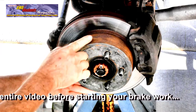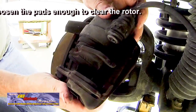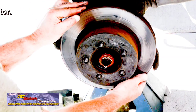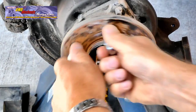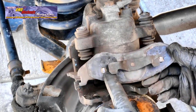Vibration when brakes are applied is often warpage and run out. Inspect the pad thickness and condition, and inspect the rotor carefully. Take care not to damage the brake hose, and check for bearing roughness by rotating the flange. On the backside of the pad you can see the two pins that had to clear the caliper.